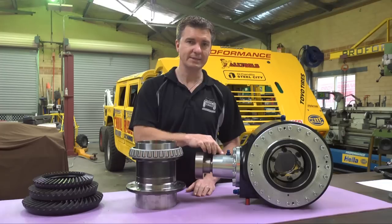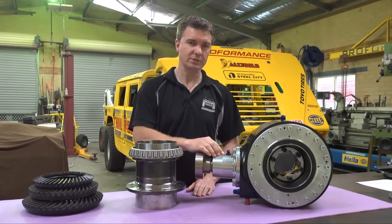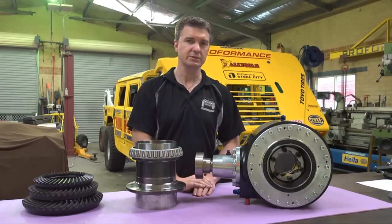From the oil cooler, it returns back into the pinion carrier. The pinion carrier is flooded and pressurised with oil, which then feeds in a spray pattern over the pinion gear, spraying oil over the teeth of the gear, better lubricating the differential.